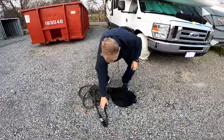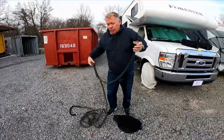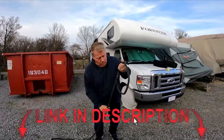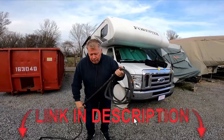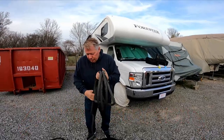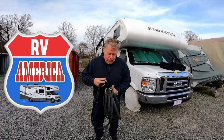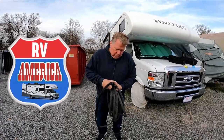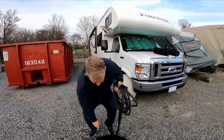Now the black water hose is really important. As you've seen in some of our videos — which I'll link above and below — having a separate hose for rinsing your black tank is one of the essential things. It never touches your black tank directly, but using your fresh water hose for that could cause a contamination problem. You definitely don't want to mix those up. Always re-thread them together to keep the water in.